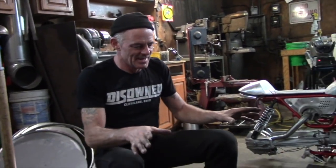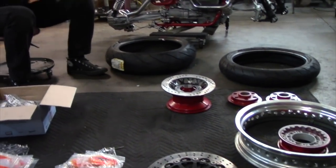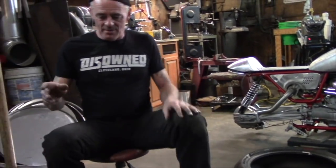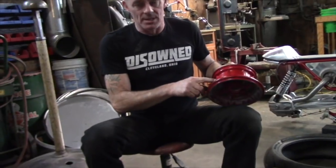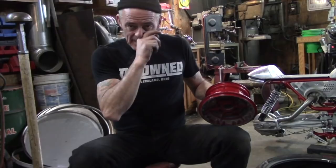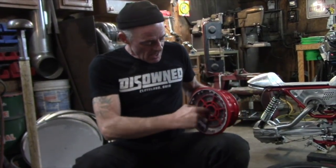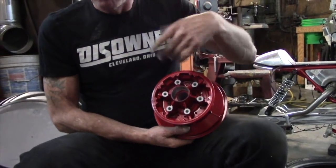Here's some of the stuff I've gotten together to somehow put 17-inch spoke wheels to the right width and make it work with those forks, the rear end, and everything. I ordered a hub for a V7 from Moto Guzzi - it came red, not this red. I had to strip it and send it to Dusty at DC for powder coating overnight. I machined out this side to take a bigger bearing, which it needs for the V9 - bigger than the V7.